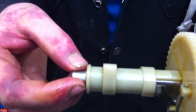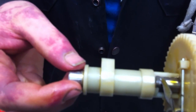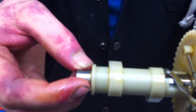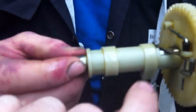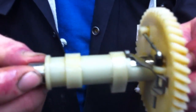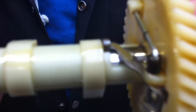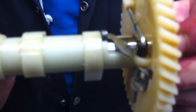As we continue to turn, the piston's now going down — she's on induction. As we continue to turn, she's coming back up on compression. At this stage we would expect both valves to be fully closed. But if we inspect the exhaust lobe, we can see at the back of the lobe there is this lump here, which is going to lift the valve off its seat.